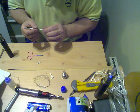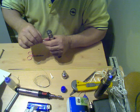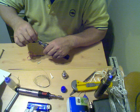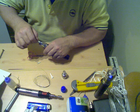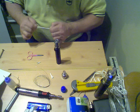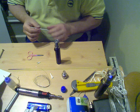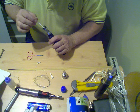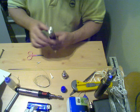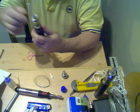Gently, gently, gently form that bottom end to stop it fraying, then twist it in and keep hold. This is the really dodgy bit — getting this to go in there. You've got to keep pulling because if you don't pull it, it goes back. There you go — push that down on the bottom and there you are, that's that in there, insulated from the bottom of the tank.